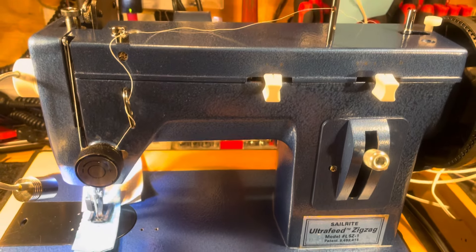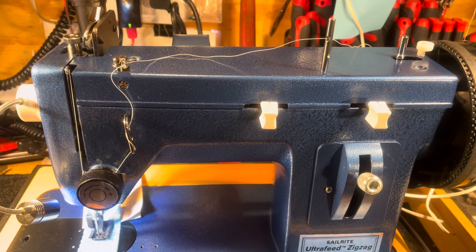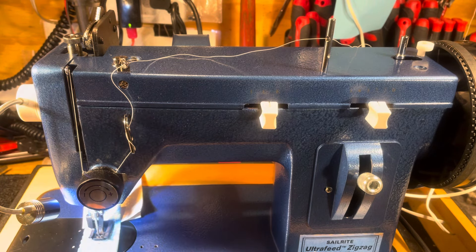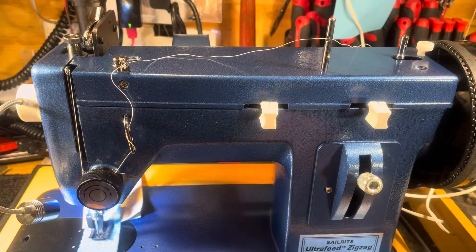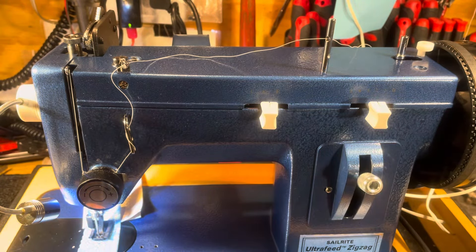If you're looking for a Sailrite — if you're looking for a used one — know that this little part is in there. Make sure it zigzags. If it does zigzag, chances are it's going to keep on zigzagging, because that means this part isn't frozen. If you go to zigzag and this thing starts jumping and chattering back and forth — watch out. It's getting ready to break if it hasn't broken already. Because you know you're going to have to get that replaced. And it can be replaced — it's not a big deal. You can probably do it yourself if you're pretty clever and mechanical.